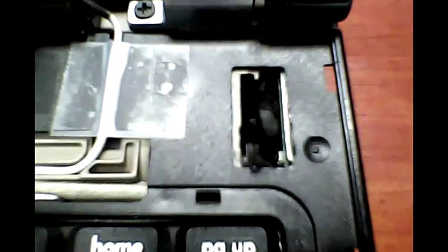Here's how I'm going to do it: tape down there, tape down there. See down there? That's a little white Molex connector — a two-pinner — that's where it's going to go. Taped it down. Here's where the actual bay is; that's where your CMOS or RTC battery would be.